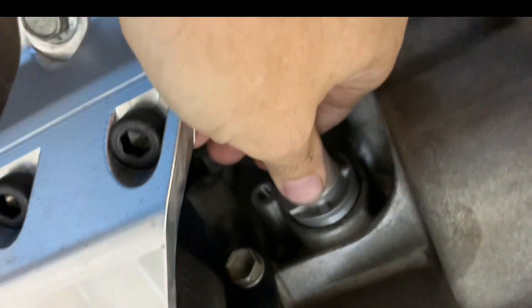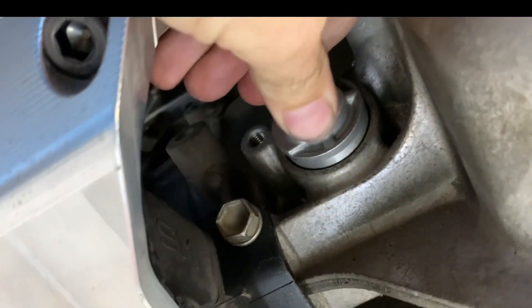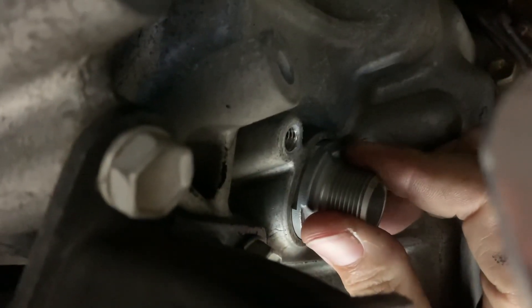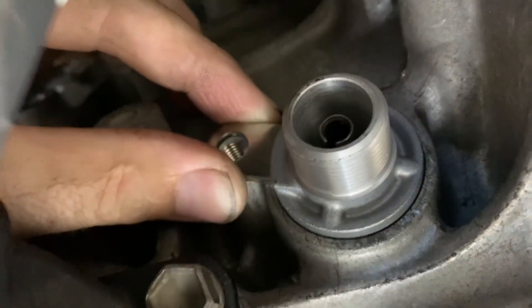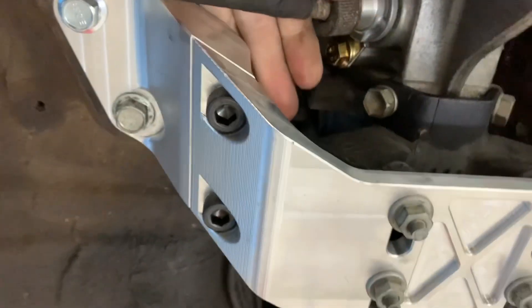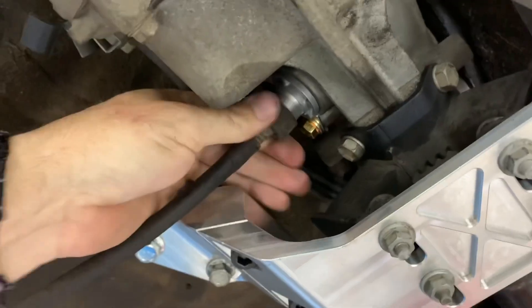The new adapter installs pretty much the same as the electric sensor. There's an O-ring around it, so be careful when you insert it — make sure it seats all the way in without damaging the O-ring. You'll then rotate the gear so that the slot in the side is aligned with the hole on the side of the transmission. The included clamp holds it in place. Now that the adapter is in the transmission, you can simply install your old speedometer cable just like you would into a T50 transmission. Make sure it is snug and free of debris before you put it on.